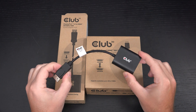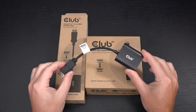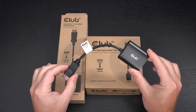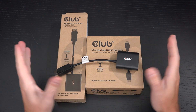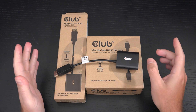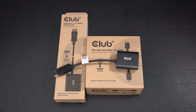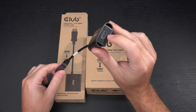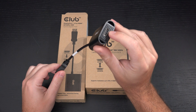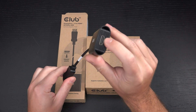There are handshake issues. For those who don't know, a handshake issue means a loss of signal. That will occur — and it will always happen in my experience — when you are changing resolution or refresh rate. Whenever you make those changes in the NVIDIA control panel and hit apply, the signal's gone. The LG 48-inch CX says there's no input, and you have to either cycle the power on the television or disconnect the HDMI cable from the TV or monitor.